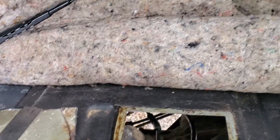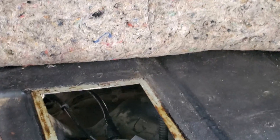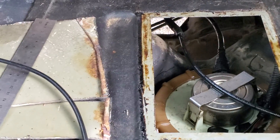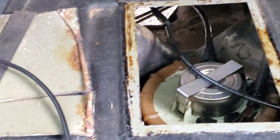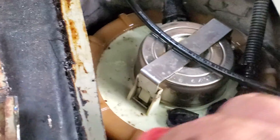Now we can take and replace it. I replaced all the fuel line with new fuel line that we picked up at the hardware store. The gas sprayed on there and made that rubber stuff clean up real nice for us, so now we don't have to clean it off with any special lubricant or adhesive remover.